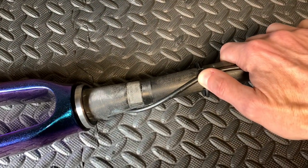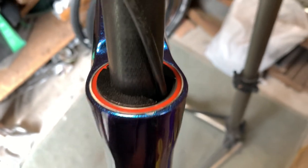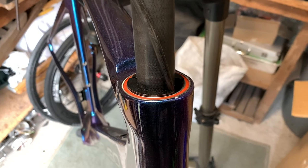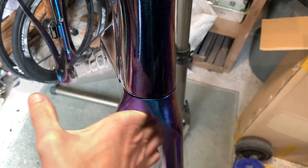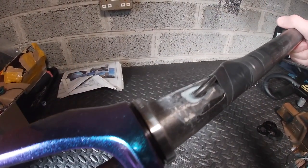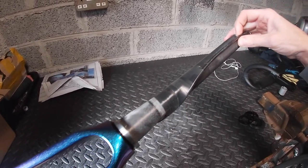It will be much better if it came out of the front, but it doesn't, and it's really annoying. I want to put it in the frame and show you what I mean. You can see the ring in the bike - it's not pointing straight at the side and it needs to be right at the front. There's another issue: when I turn it about there on the forks, the hydraulic cable is hitting something inside - it's the side of the tube there. So what I've done is taken it out the back and used some electrical tape to stick it to the front how I need it.